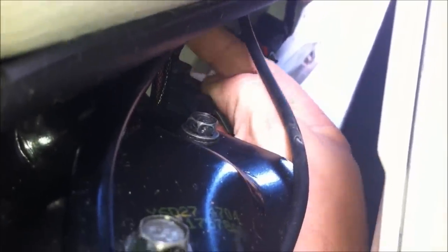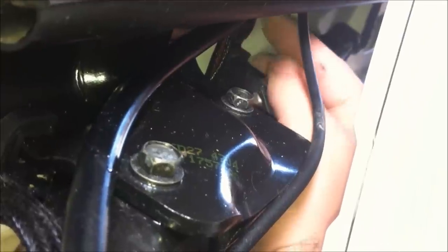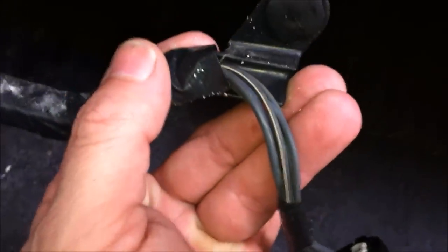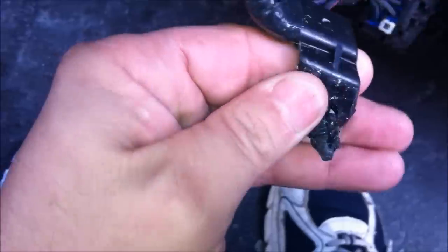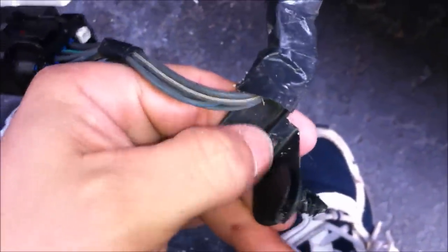There's a little push pin right there — a popper. Go ahead and put a flat screwdriver up underneath here and work it off carefully, because if you force it, it'll scratch your paint and break the little plug piece underneath. Right where my finger is, there's a little circle — there's no easy way to get under it unless you get underneath the harness. You may need diagonal pliers to get up underneath the harness and pry it back and forth until the little teeth let go. Be careful not to break the harness, as that's what keeps the wiring up and out of the way.